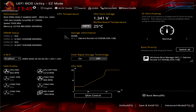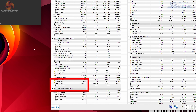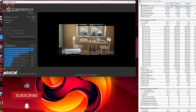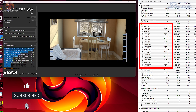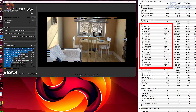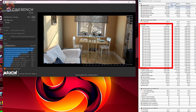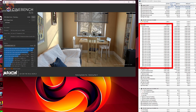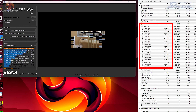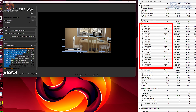That's encouraging — let's see how our new Core i9 behaves on Z690. Default settings on this motherboard give us unlimited boost power and sustained power of 253 watts. Let's see what happens in Cinebench 23. 5.5 gigahertz on the P-cores — who would have thought that Intel would be the kings of backwards compatibility, unlike AMD with their AM5 platform.